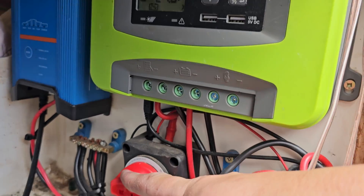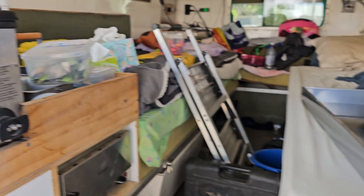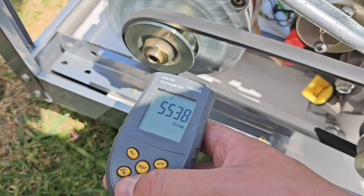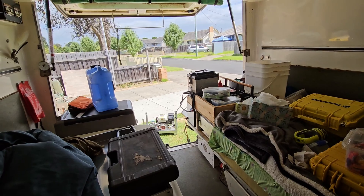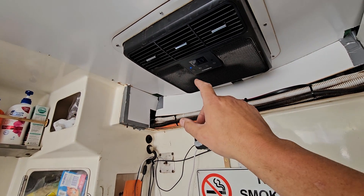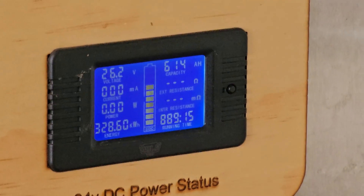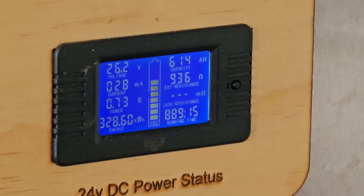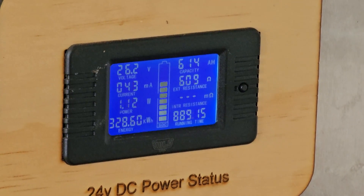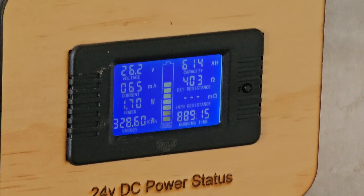I've disconnected the solar — turned off the isolator to the solar panels. We're running purely on generator now. We have the fridge running and we're about to add a bigger load — about to add 14 amps. I'm hiding out in the back with 14 amps running, no solar, and now I have to put the air conditioner into boost mode which should add about another 30 amps to it. I've got the air conditioner running. I've turned off the boiling vessel, removing about 14 amps. The air conditioner pulls around 30 to 35 amps, and now our battery system says we're roughly even and starting to climb slightly — which is the whole thing I needed that generator to do: keep up with the air conditioner.